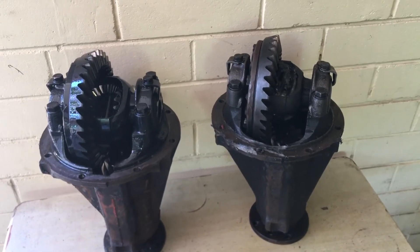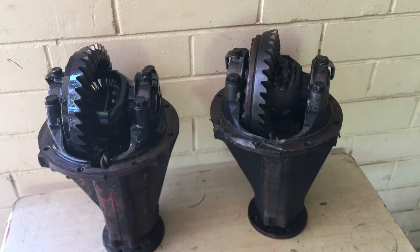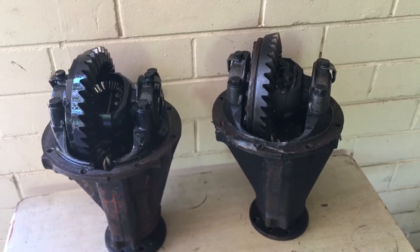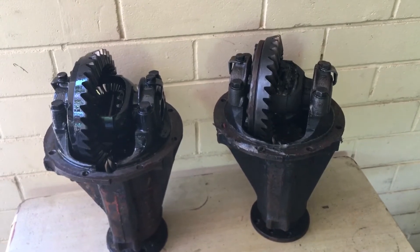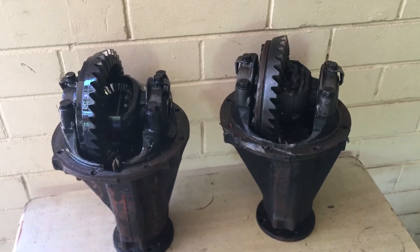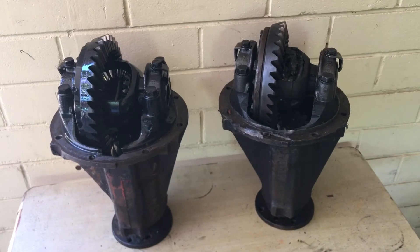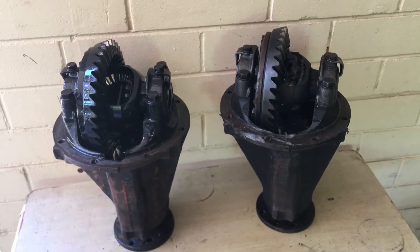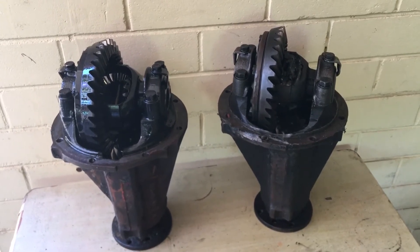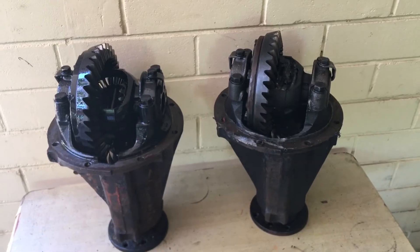What's the difference? Well, what you want the car to do basically dictates what final drive you choose. If you want a car that accelerates really quickly — like a sprint car, drag car, or rally car where the engine is going to be working in the power band most of the time — you're going to want something like 4.11 or triple fours, maybe even higher, depending on your gearbox ratios. If you want something with a bit more range that cruises nicely on the freeway or motorway, you'll want something lower like 3.54 or 2.89. 3.77 is a sort of happy medium — pretty good acceleration and not bad top-end speed, with the engine not really revving its head off at the maximum speed limit. So that's my personal choice.